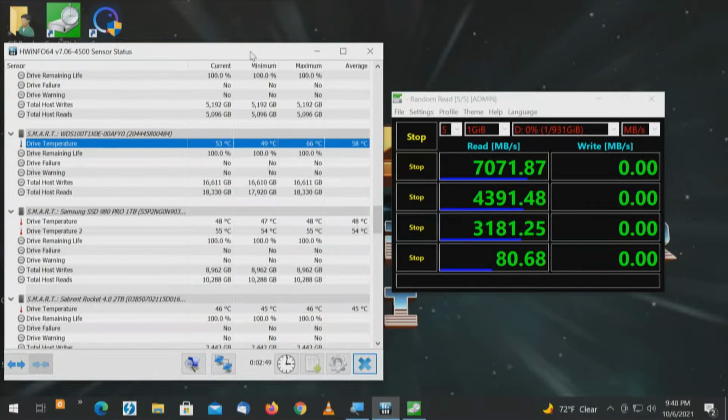So for those of you that did not catch the reason and the results, whatever's going on with the WD Black SN850, especially on the X570 chipset, but as it relates to the Gigabyte Aorus card, if you're not getting the right performance out of that drive, you may need a firmware update. And that's what we did. You saw the results. You see where we're at. Okay, the writes per megabyte, I'm good with that. But I'm going to let it finish.